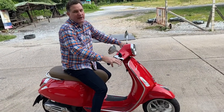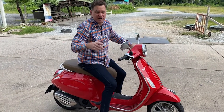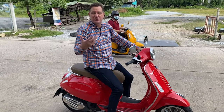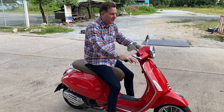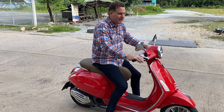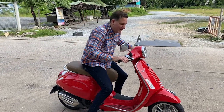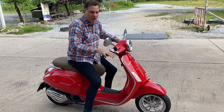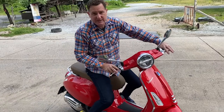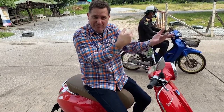Now, just so you're aware of the difference, as I'm moving along, the rear brake actually applies quite gently, whereas with the front brake, momentum and inertia come into effect, and you'll see the front wheel dip a little bit. Now, a common problem with beginners is they grab the front brake, all the weight shifts forward, and then the wheel turns, and then they fall off.